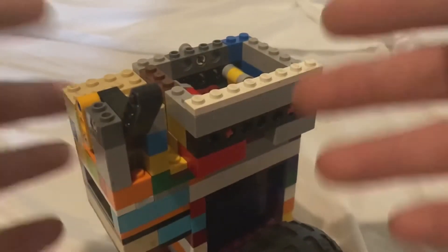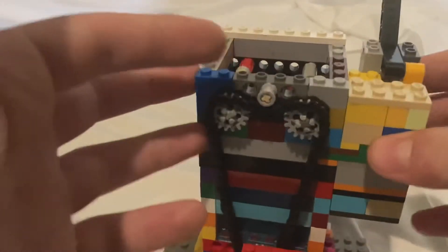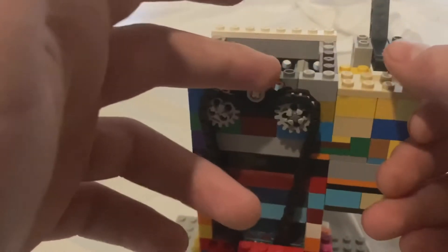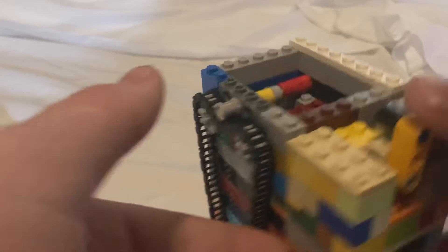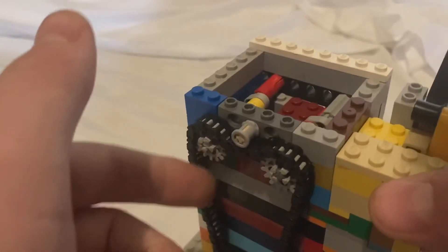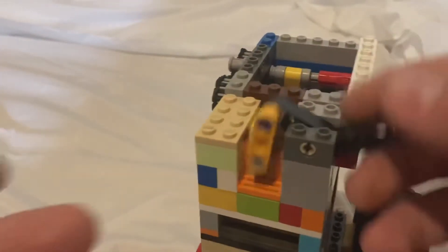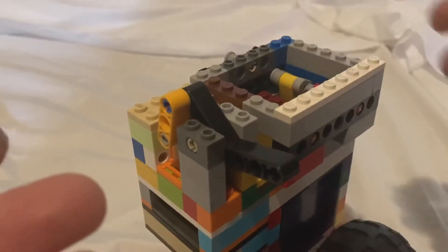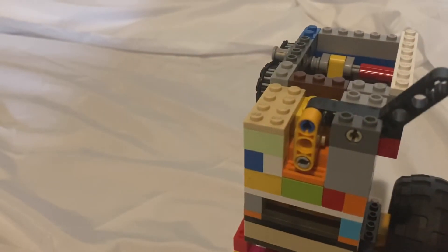I will say this isn't super reliable in terms of timing. I had issues with the timing — that could just be me not having good tension. This is all I got for tension and that seems to work, meh. I've had instances where the timing chain would skip and fall out of timing, and the engine would run, but at full throttle — which is what it runs at — it pretty much runs at idle speed if you give it full throttle, and at zero percent throttle it doesn't run.